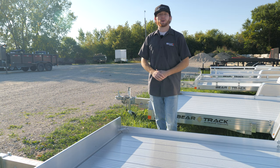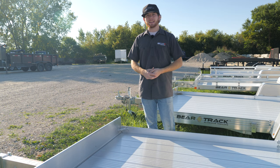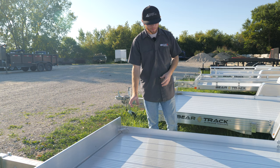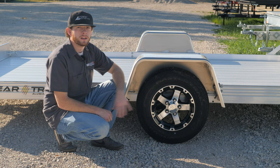When you get your perfect trailer and you know exactly what you're going to be hauling — let's say we're hauling a Polaris Ranger — we do have some tie-down points here, they're also brace points so we don't want to pull too hard on them. Once you get your Ranger up here, it's always a good idea to buy some D-rings. You can buy flush mount — there are tons of different styles of D-rings — but mount them to the trailer so as soon as you pull the Ranger on, you can hook four straps very easily and you're safe while hauling it down the road.